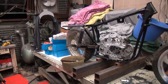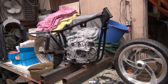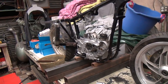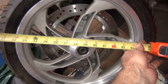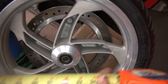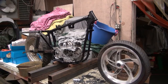And if you put a 17-inch wheel in the back, it would drop down a half inch in the back maybe. That's an 18, so they're a little bit smaller diameter too. So with a little bit longer fork and a little front end sag, you'll be about this height when you're riding the bike. With our rake up here, you figure about that much dimension on the top. Down here you're about 31 inches by the time you get way out where the wheel will sit, so 32 would bring you up about an inch. When you sat on the bike, you'd have a little bit of sag, which would put you about right. So it would want to sit about at this height here.